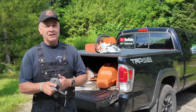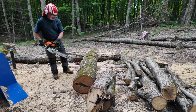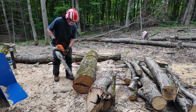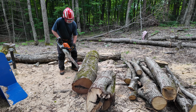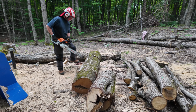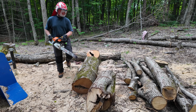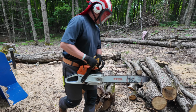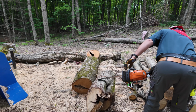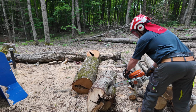I don't think so, and I'll tell you why in a second. But I think the challenge that I have, and probably many of you have, is that you're not in an area where you have the same type of wood that you're bucking every day. You've got a pile of logs, trees that you felled, different species, and some are green and some are close to season or very, very dry. So in the same log pile, you're not going to keep trying to adjust your oil. You try to keep it at a point where you're not burning the bar and you're able to cut, and you're certainly not seeing smoke, which I have seen in the past. So is that what contributed to the issue with the saw?